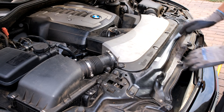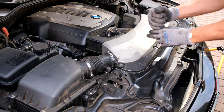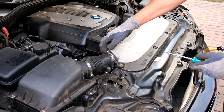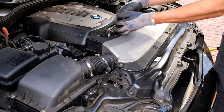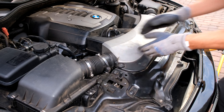The first thing I'm going to do is remove all of this. There are a couple of screws here — this is a T30. You'll need to remove one, two, three, four screws, then these clamps: one, two, and three. Then there's a plug here. I've just opened the cover — just push it at the back and lift that off.